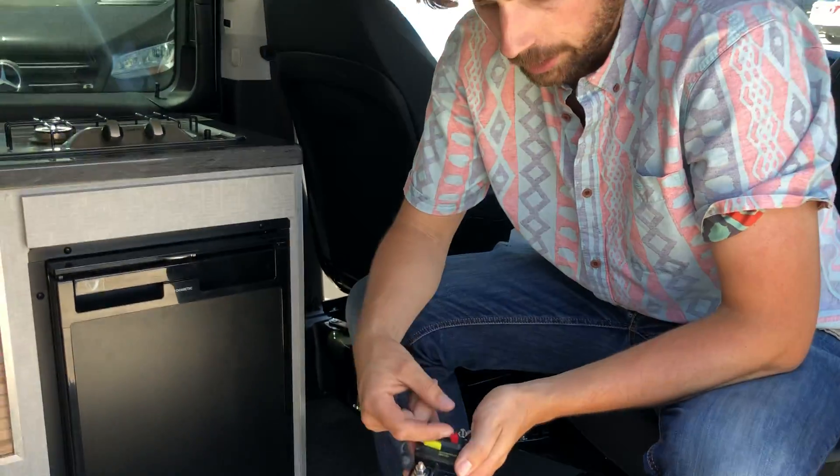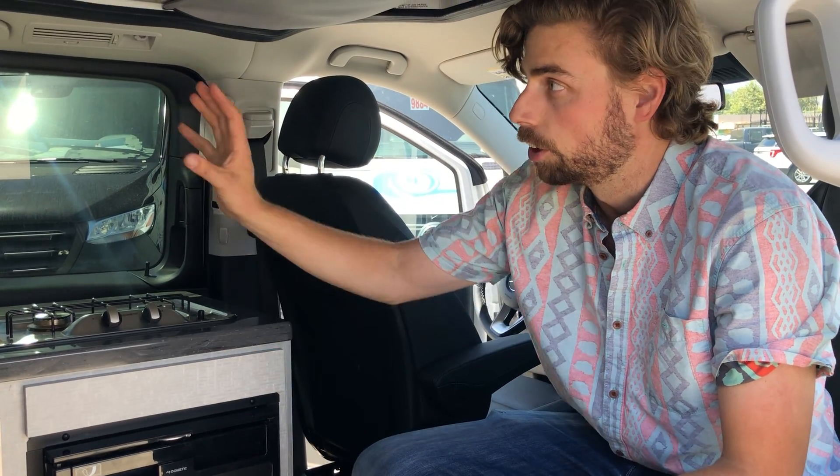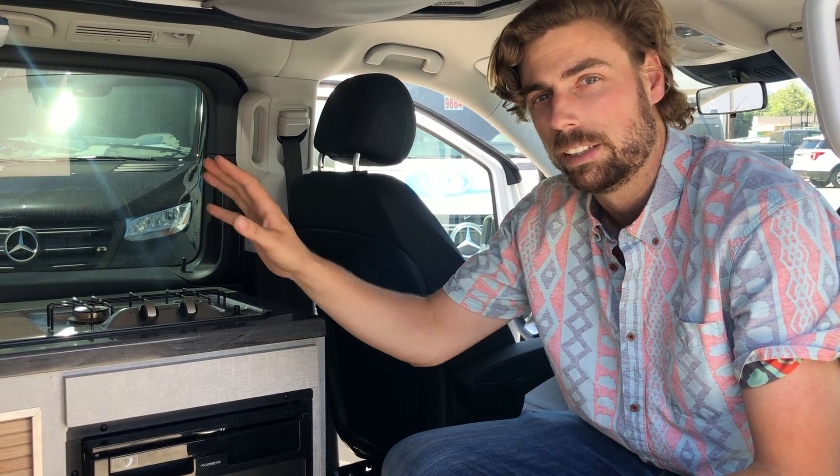You can tell that these are tripped because that finger pops out. One more thing to check is your Victron battery monitor. If that battery monitor is just turned off completely — there's no indication of voltage or percent charge, nothing on that screen — the auxiliary battery is either dead or has become disconnected somehow.